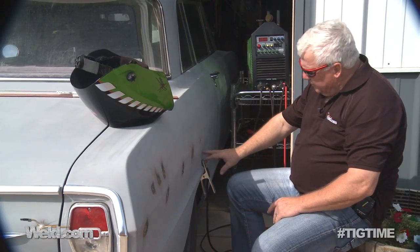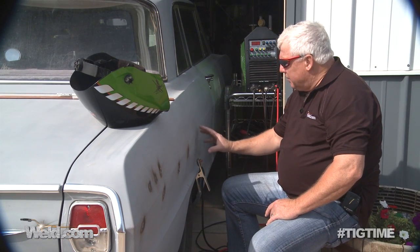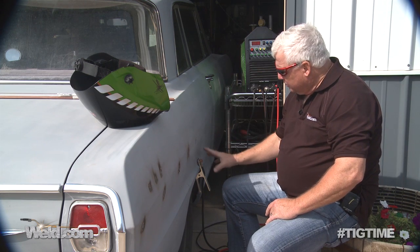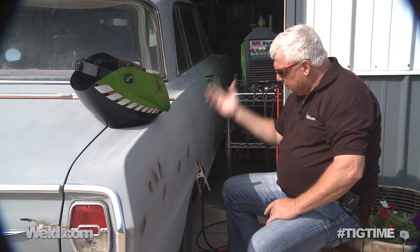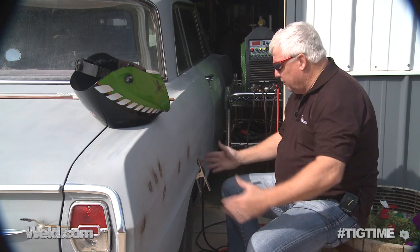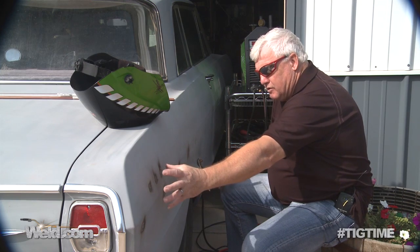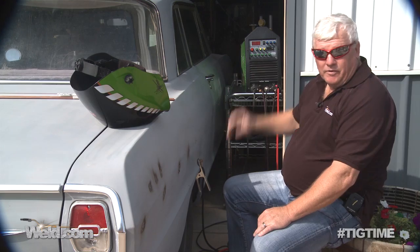You know, when you're TIG welding and you put a ground clamp real close to where you're welding, you don't have to be concerned about the electronics in your car such as your battery. So just make sure you get this well grounded when you do this. You can see I'm within six inches away — all of these that I have welded, my path is from where I welded to right here. So make sure you don't just clamp on the car somewhere.